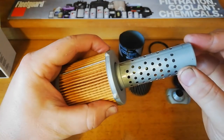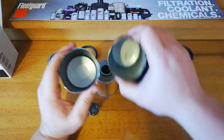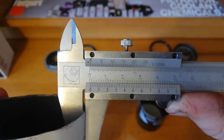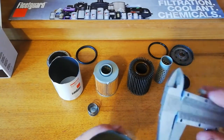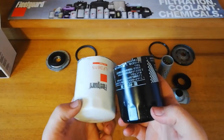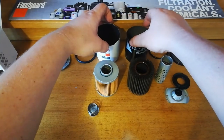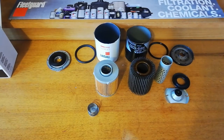The holes on the Fleet Guard are a little bit bigger than the Toyota one. The actual Toyota centre tube looks to be about the same size. The Fleet Guard can feels a little bit more robust - they've got 0.6 to 0.7mm, whereas the Toyota is about 0.4 to 0.5mm. So it is a little bit thinner. The Fleet Guard's a bit more robust. They've both got all the notches for your tool, so they come off easy enough.